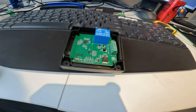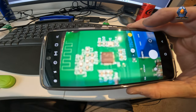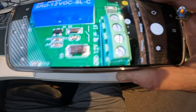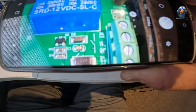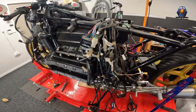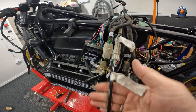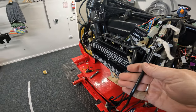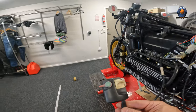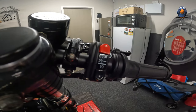According to the labeling, the first one is ground - that actually worked. Then 12 volts - I'm expecting black and red. There are those four colors on the ignition switch. I'm going to splice this - not going to use the original connector - I'm just going to splice it and put the box in line. The emergency cutoff switch is obviously still wired to this side. I just have to check if the connections are the same.